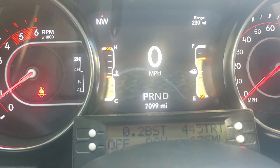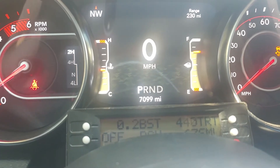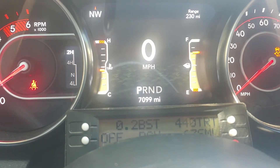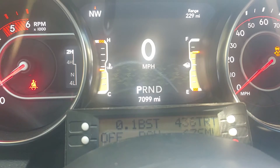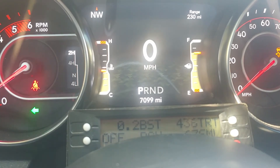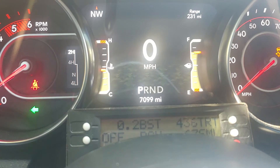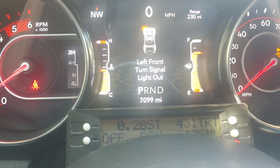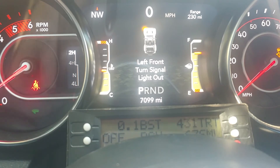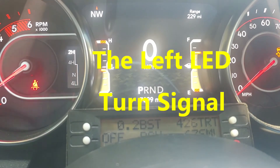I want to do a quick demo to show what happens when you put non-factory LEDs on. I've disconnected the left turn signal. When I turn the turn signal on, it may go straight into burned-out mode or blink correctly for a bit first, then switch to burned-out mode. Going ahead and turning the left blinker on — it's blinking correctly even though it's fully disconnected. But the logic will catch up, start blinking super fast, and the info display will come up saying 'left turn signal burned out.' There it goes — you can see the left signal indicated on the picture and the green light blinking fast.